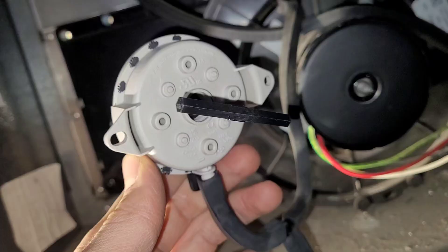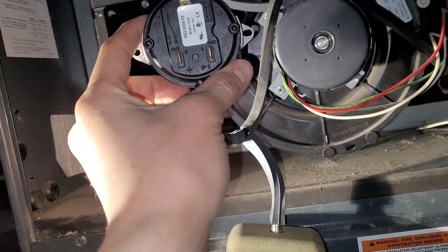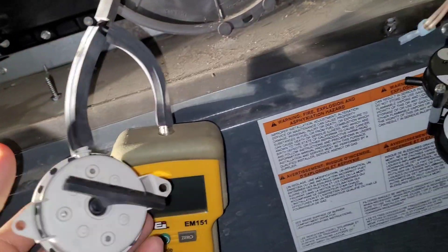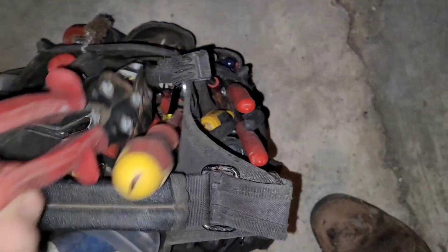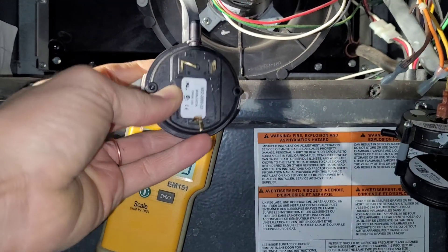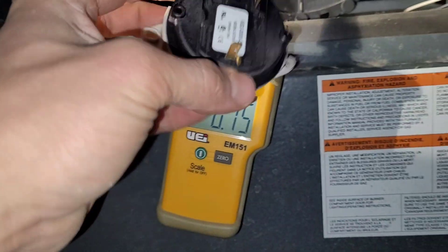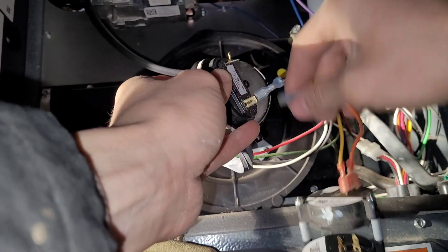Now we'll get this mounted. It does need to be in this position. You could put a glob of hot glue on the back to prevent anyone from changing the adjustment, but I usually don't worry about that. The terminals on the new switch are the wider style and the ones on the existing switch are the narrower style, so rather than changing the ends, I take my tin snips and cut a slot — not all the way through — and then it's actually great for troubleshooting because you can put your test probes onto those little slots. Now we can plug the terminals right back on.